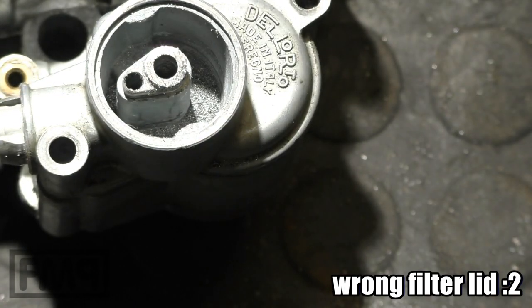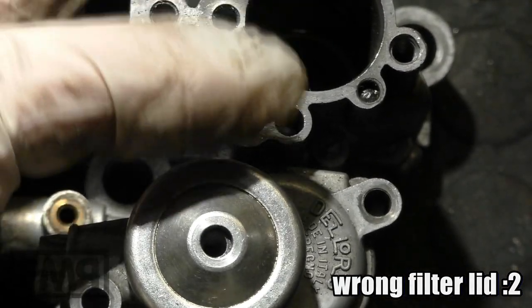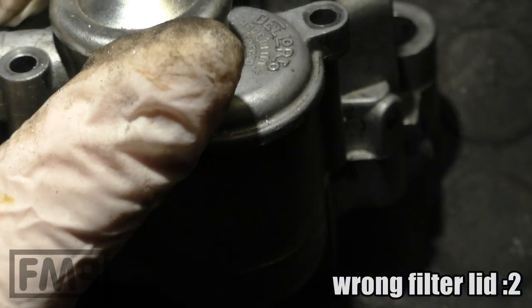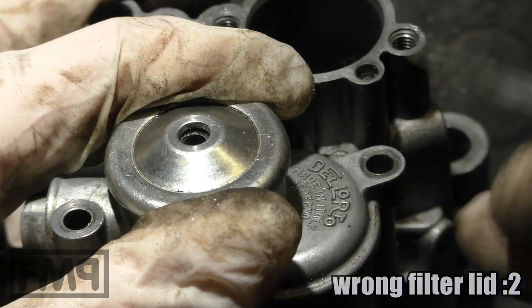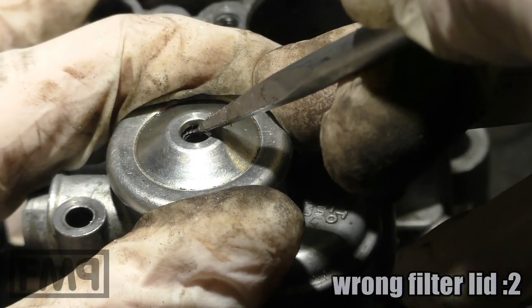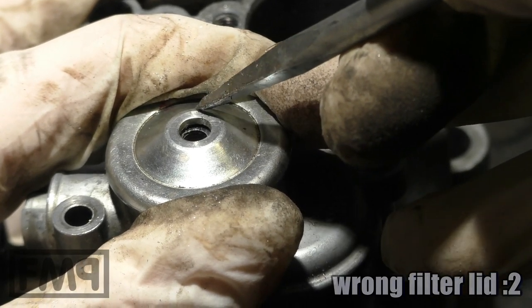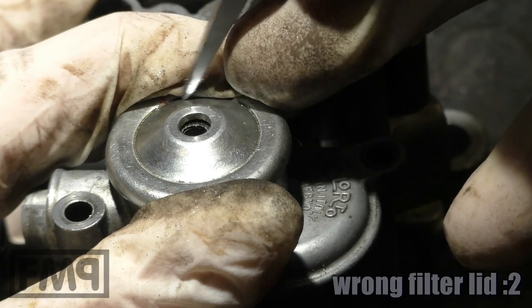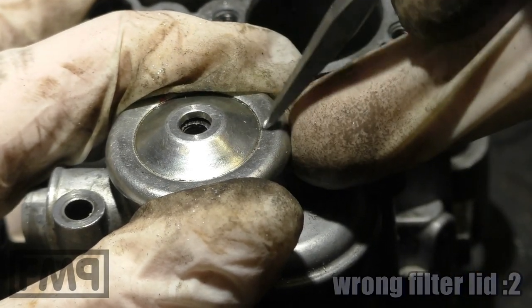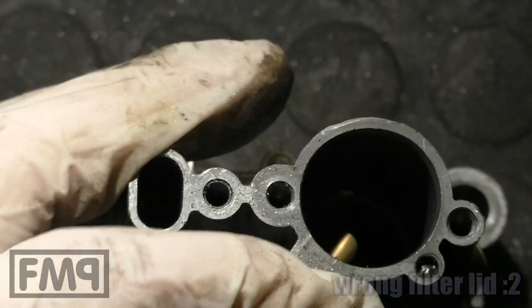Now, put on the lid again and check if we now do have the gap. And you see, we have a gap now. The thread is lower than the top of the lid. So if you put the screw in, it will push the middle of the lid down and can raise some pressure on the outer side to ensure that this is tight.